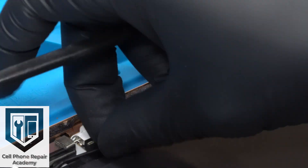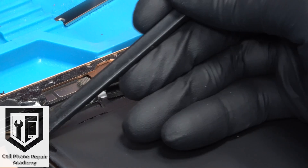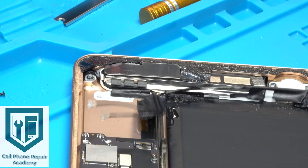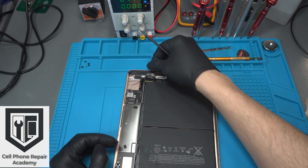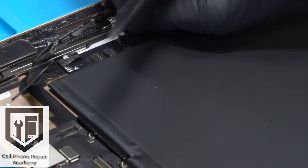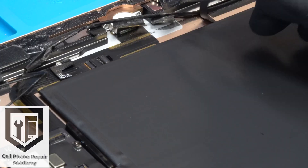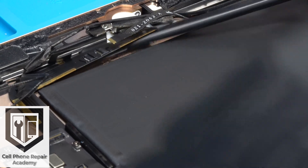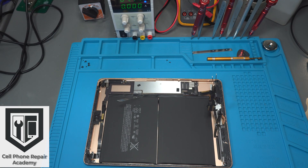Next we work to remove the wifi antenna flex cables. Take the spudger with alcohol to loosen up the adhesive around the flex cables and with your fingertips work to loosen them up gently. Finally, with the spudger disconnect the antennas from the connectors. The charging port flex cable comes with the connectors to the speakers — these connectors are covered with tape, so use the spudger with alcohol to remove the tape and expose them. Unlatch the connectors and pull out the cables. With your spudger, get a dab of alcohol and work your way under the charging port flex cable, making sure to loosen the adhesive that holds it onto the frame.